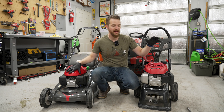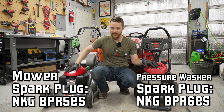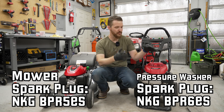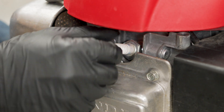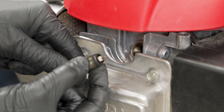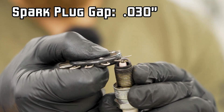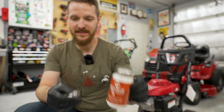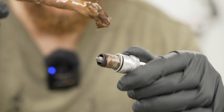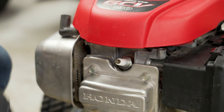The last thing we're gonna do is check the spark plug on both the GCV 190 and the 200. I did some research and the application changes the spark plug — I'll have the information on screen or in the description — but the pressure washer uses a different spark plug than the lawn mower. You're gonna need a 21 millimeter socket to pull both these out. This spark plug is definitely in good shape, does not need to be replaced. There's a little bit of carbon on there, but not very much, and it's not oily, so we're doing fine. Before putting the spark plug back, I'm gonna check the gap, which is supposed to be .030 of an inch. We're there — perfect. I'm going to apply a little bit of anti-seize to these threads, just a tiny bit, to make sure they never get stuck. Thread this in by hand, and since we don't have a new crush washer, it's just a tiny bit of a turn. That's all you need, and that is done.